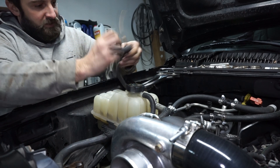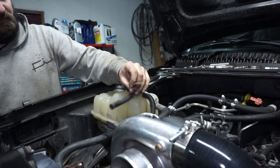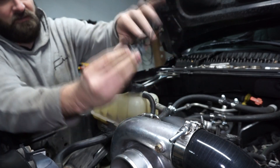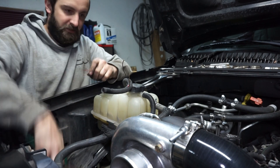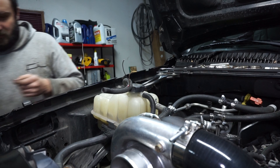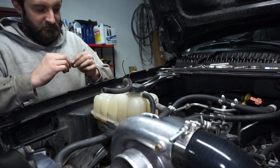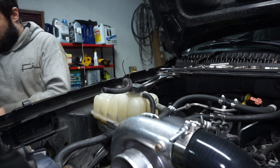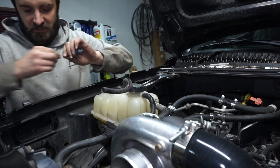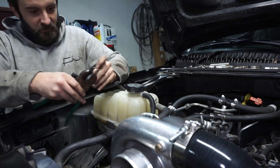So we're going to re-loom this and it'll almost look like we tried. I'm going to tape a plug onto the wires — I actually had a temp sensor sitting in the drawers, so I'll steal the plug off of it. It basically doesn't matter which way you hook it up because there's no polarity on these things — it's just resistance-based. One side gives you the signal out of the computer, the resistance changes, and the other wire goes back as an input, and that's what gives you your temperature reading.